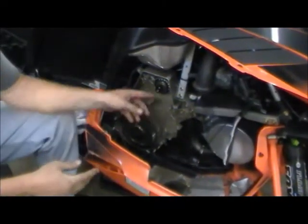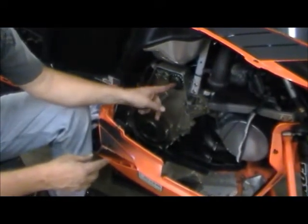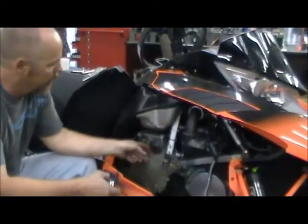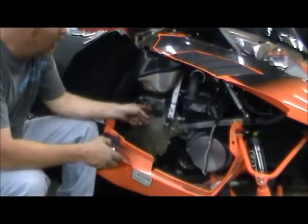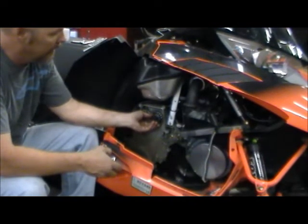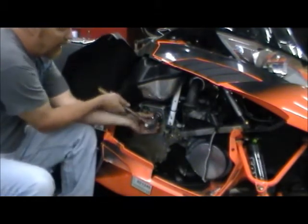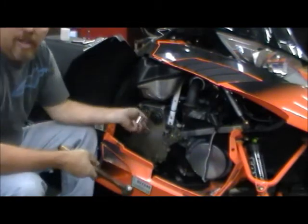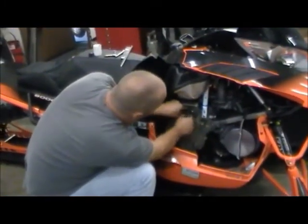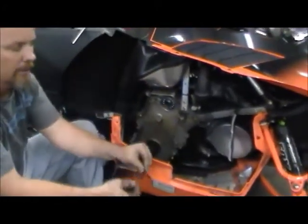Part of the upgrade of our kit is we get rid of this taper lock on the 12 through 14. You'll need to undo this snap ring here and then undo this lock collar. At this point we've removed the snap ring and all the spacers in between it and the lock nut. We've loosened up this nut. Now I'm just going to use a socket to go over the jack shaft on that nut and unlock the taper. You need to get a pick under this one — it's one of the ones that kind of twists out like that.